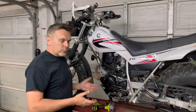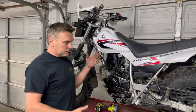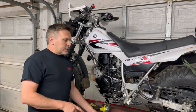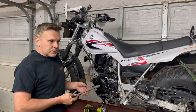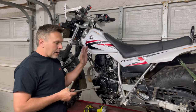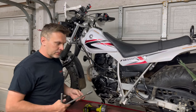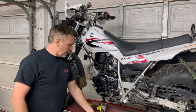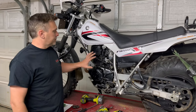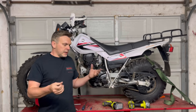You can literally be done with just four tools and a few minutes of your time. Double check your work and make sure you've done everything correctly. It is good practice, once you think you have the timing set correctly, to rotate the engine a couple of revolutions and double check that everything is correct. This one's been apart and back together many times so we know this one's right.